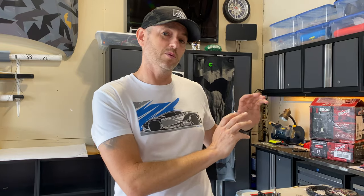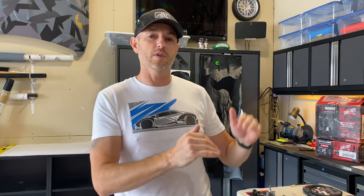Not only do they help with the bounce, they make the ride smoother, they help with any body roll or sway. I use a weight distribution hitch for my holiday trailer, and sometimes I don't even know what's back there because it helps make sure you don't have any sag, so your vehicle is completely level. That keeps the steering feel proper and it's not light because you're lifting up the front end. This isn't a substitute to be able to tow more, but it's going to allow you to tow that upper range, like I said, much more safely.